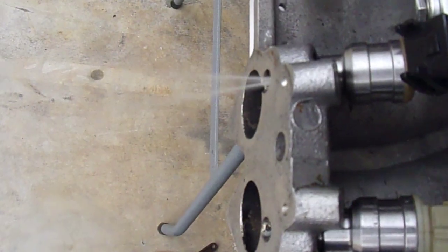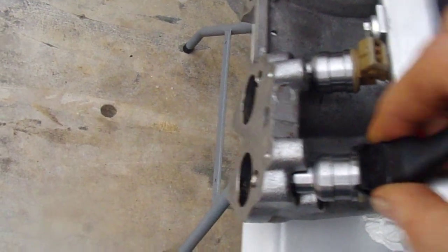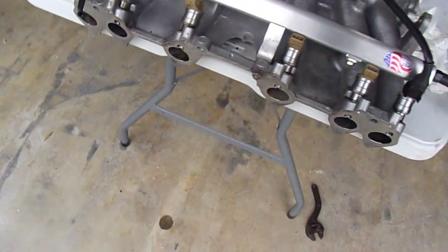The reason I did this setup this way with this manifold - I'll talk about that in just a second. Oh, I see a dripper, I see a leaker - where's that coming from? Oh, this guy right here is leaking. That's not horrible but you don't want it to leak at all. You can kind of see where the leakage comes from looking down here at the pattern - that drop right there, nobody else is dripping anything. Let's hit that guy a couple more times. They'll probably improve with use as gasoline flows through - gasoline is a good solvent.